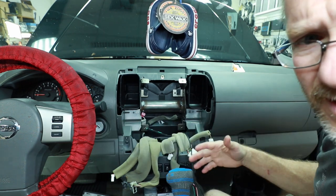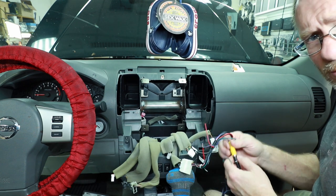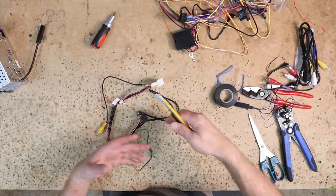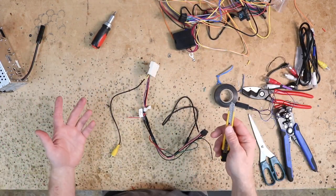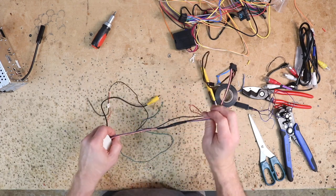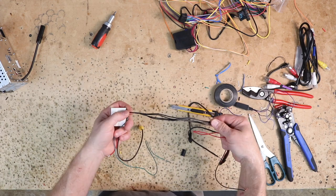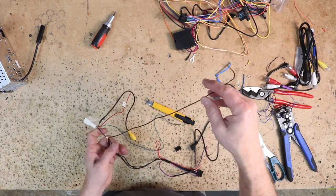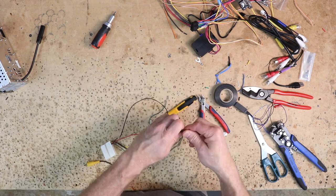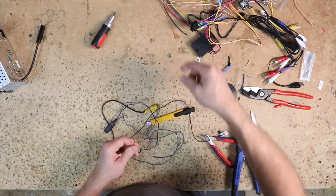There's a lot of testing that has to be done on one of these Nissans, and that's why we plug that airbag wire back in — we have to turn this on several times during installation. I'll meet you at the bench, we'll dress the harness and remove any excess wiring. The task is to blend all of this together, removing as much as I don't need. Starting with the backup camera harness — remove all the tape. It has a pink and a pink-blue; these are data wires not needed for this steering wheel control application, so just pull those out. Next is this giant ground bundle — remove the heat shrink, take off that one solo ground, remove all the excess ground wires, and the whole thing just comes off. Put the shrink wrap you just removed back aside, grab the 12-to-6 volt adapter. First wire to hook up is the blue-red — the six-volt output to the red wire. Twist the wires nice and tight and let the heat pull the solder into the wire.